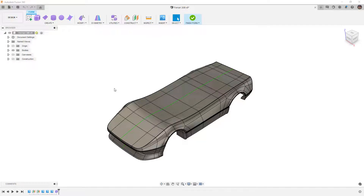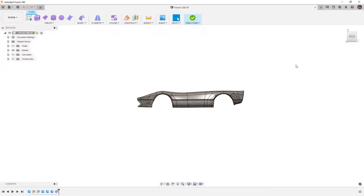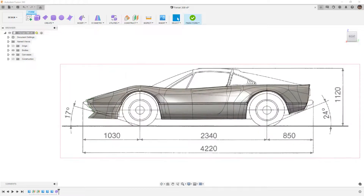We have some design decisions to make. We created the Ferrari with this sort of mid line, and that's a standard practice where you take what the middle of the car looks like and extrude it out. It's often used when building a car from multiple surfaces because it makes it easier to connect the edges together. It's more of a traditional surfacing method, and a lot of cars from the 70s and early 80s were very clear like that — if you look at C3 or early C4 Corvettes, they have ridges on the fenders and a straight mid line.